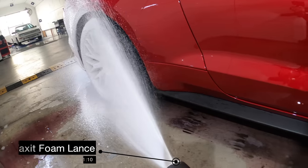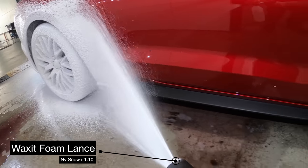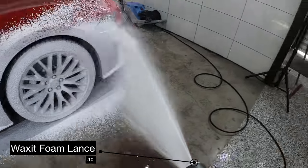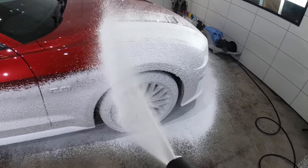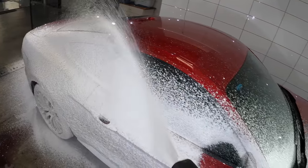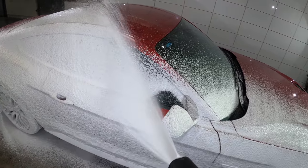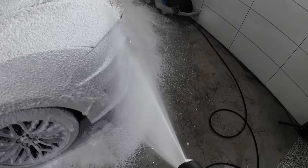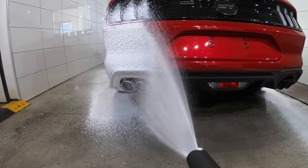Next was the pre-soak foam. So once again, using a more capable strip car wash detergent, compared to your more gentle maintenance car wash soap, this step is all about starting to soften and dislodge both the existing surface grime and any waxes or sealants in place. If you're in a cool, sheltered location, I'd personally give the foam a good 10 minutes to dwell,